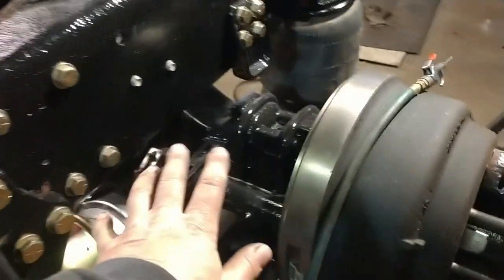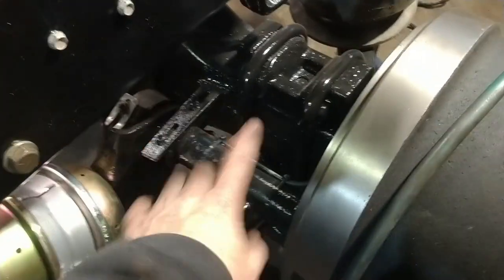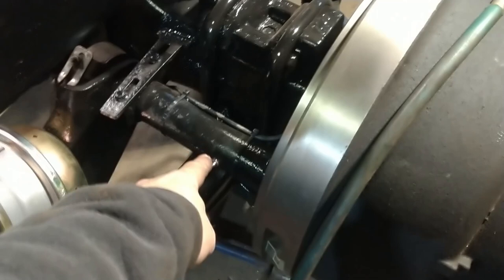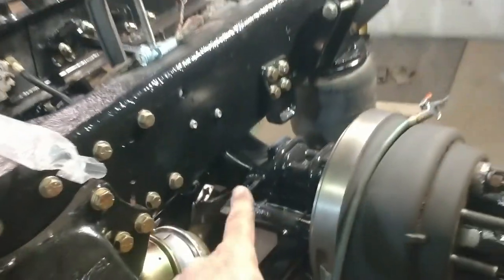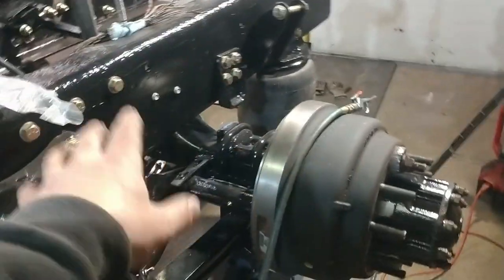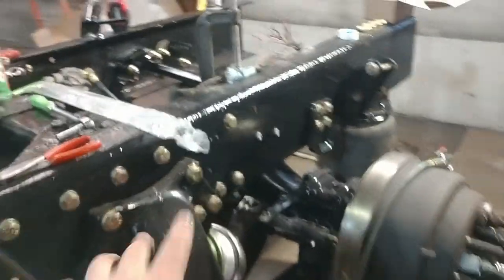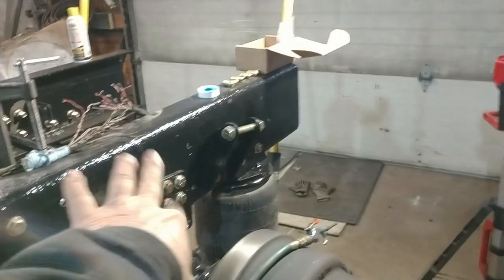Well, I think this is a good place to stop here because all the brakes are finished up now. The only thing I need to do before I leave today is I want to grease that S-cam tube and the slack adjuster on both sides so I know they're handled. I have a 5-gallon bucket of synthetic gear oil coming, so we're going to flush the rear end out and fill it back up. And next video, we will be working with plumbing up the airbags.